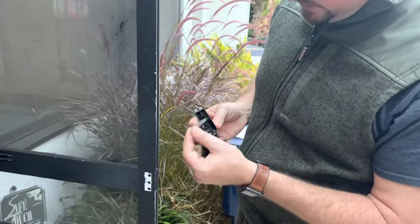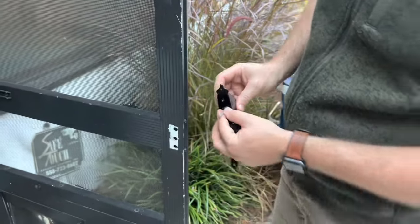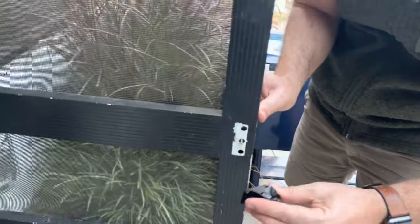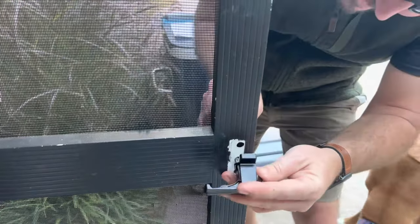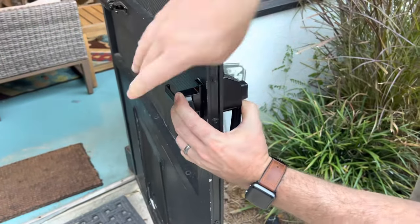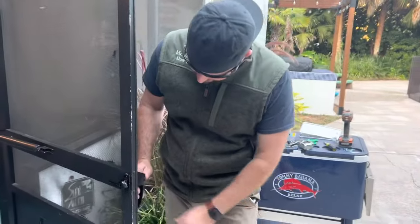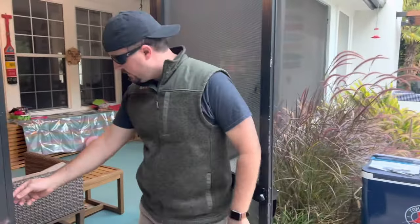Once you've got that piece set up, put the spring that comes with it onto it. The spring is pointing towards the outside with the smaller end on the outside — put it into that hole. The spring is what keeps the button out. Then put the piece of silver metal through the middle hole, make sure your other two holes are going to align, and push the other piece right in. Click it together and make sure you're getting proper function. Now put back in the three screws — the two for one inch thickness plus the one on the bottom.